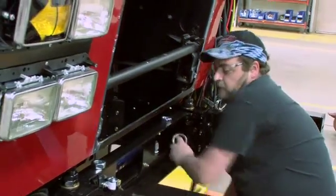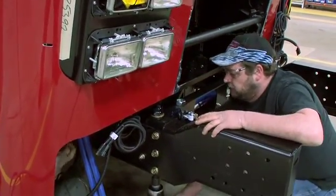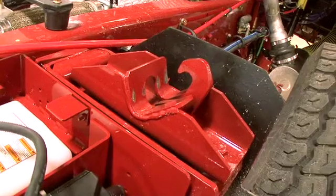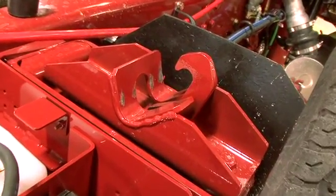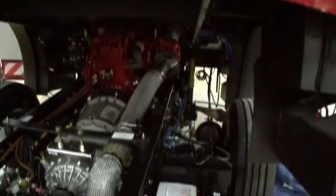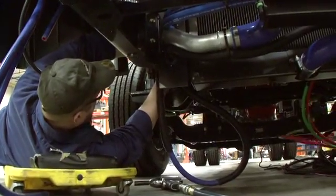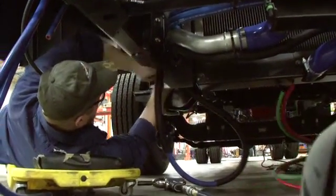The tilt knuckles are secured to the cab with 600 foot-pounds of torque. A rubber seal inside the knuckle allows the cab to tilt. The two 250-pound spring-loaded latches at the rear of the cab require hydraulic pressure from the tilt system to release the cab. Spartan's four-point cab mounting system offers greater safety and stability.